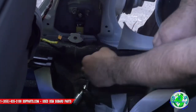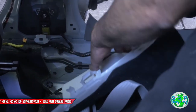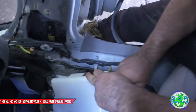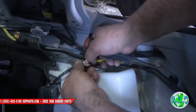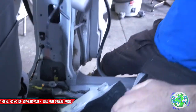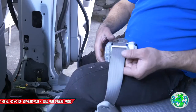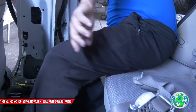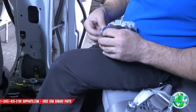The passenger side has a little sensor hooked up right here in the carpet. If you pull the carpet back, it's right here — go ahead and unplug this. There's your seatbelt — gone. And here's our new seatbelt. Someone took the bolt out, so we need to rob it from our old seatbelt.